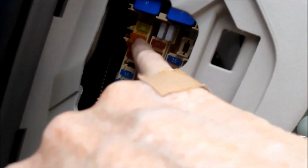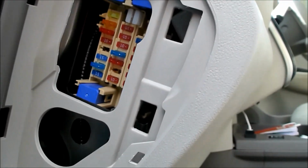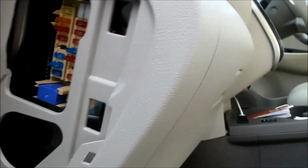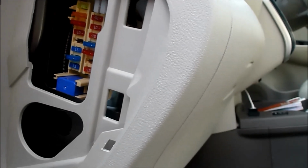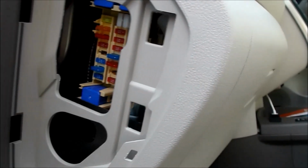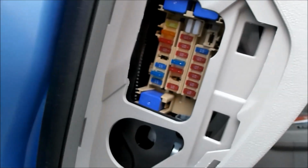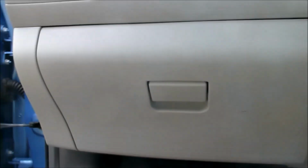That's the fuse there. It's a 5 amp fuse, which is a bit overpowered because this is only running at 0.5 amp, but I don't have anything smaller lying around, so 5 amps it is. And otherwise, that's reasonably tidy. Throw this back on. That's good.